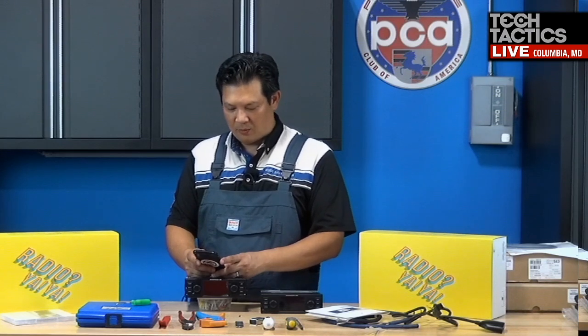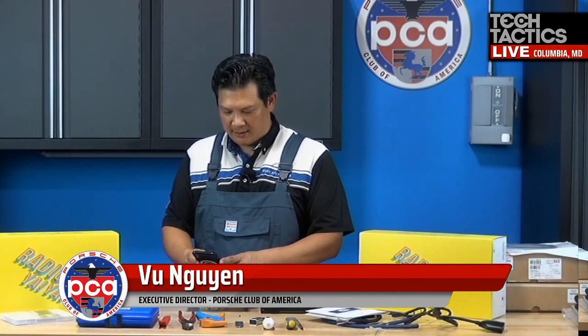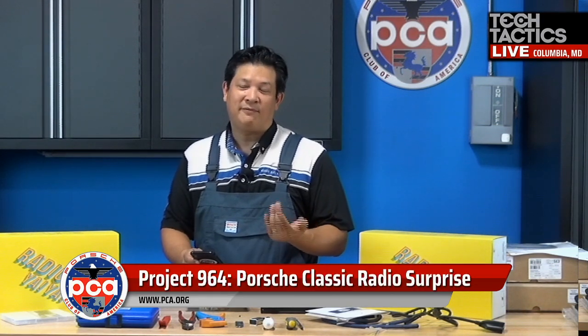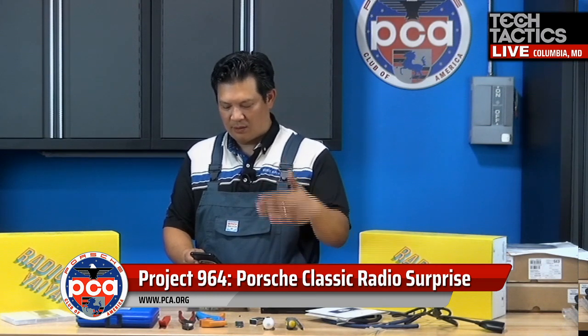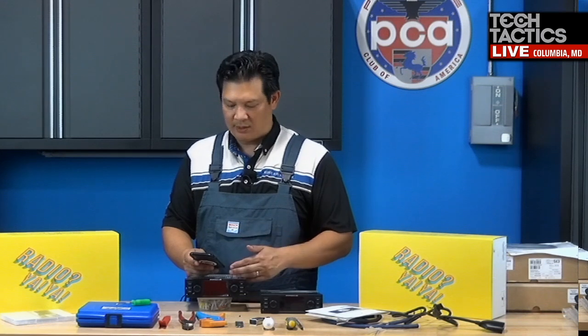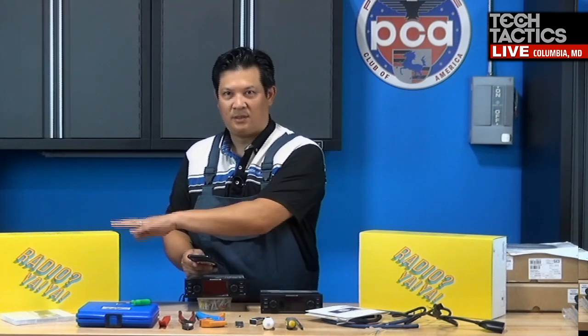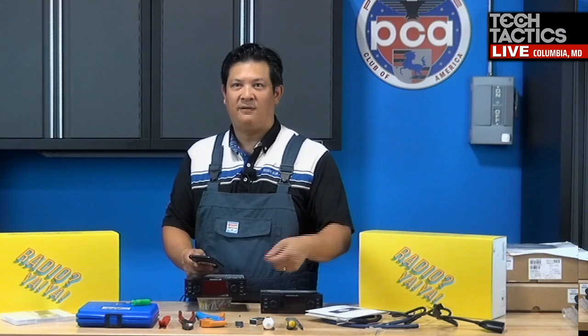Okay, gotcha. All right, so someone here, Arthur Rosenberg, had a question about his 993 with a CR210 that he replaced with a CDR220. That's just a radio upgrade from an older factory head unit to a newer one. If you were to move to this Porsche Classic radio, you'd take out that CDR220 and put this one in its place. Because that radio would not be plug and play, you would have to build the harness, which comes in the box, and then with the harness that's inside your car, have a radio shop, or if you're handy yourself, figure out the pin configurations and the speaker outputs and such.